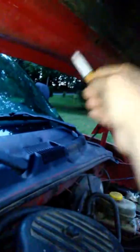look at that, I don't have enough top clearance unless I bevel the hood, which they could have easily done and got the top clearance on that hood by simply putting a square. You put a square in first, and you close it to get the idea of how much clearance you're going to need with the carburetor. You lift the hood back up, and then you put your round bevel square, and then you take it over to the press and you press it.